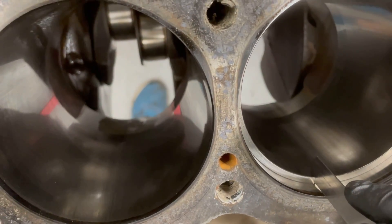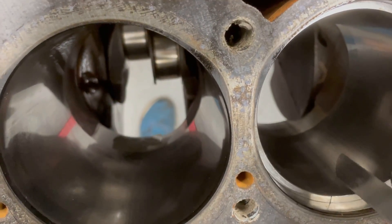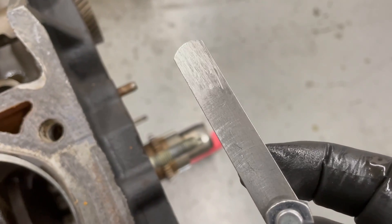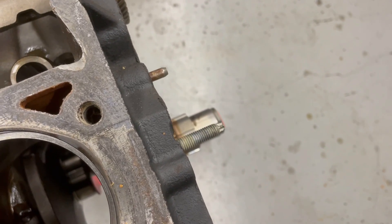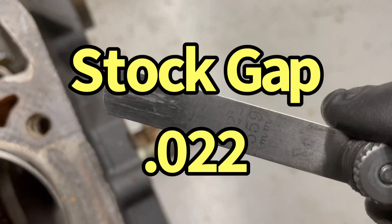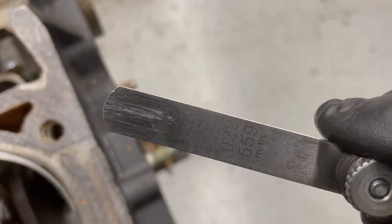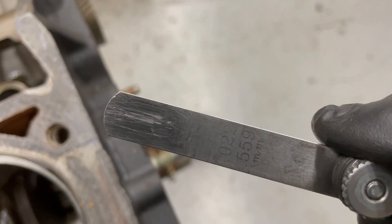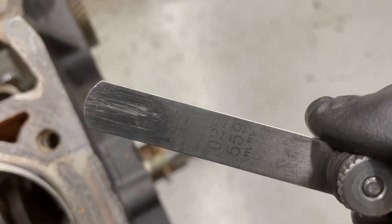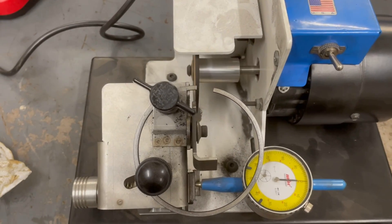That size does fit. It is a 22 thousandths — so I was pretty close. I'm going to take a little bit more gap out of that. This is basically a 3.8 inch bore, so I'm going to add a little bit more than that. That's kind of on the safe side for a 3.8 inch bore — maybe that's why we can run boost on a lot of these — but I'd like to see it up a little bit higher than that. Let's go over to our ring tool and I'll show you how to add even more.